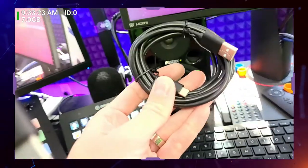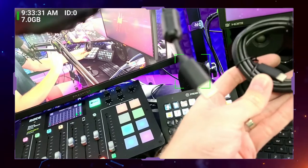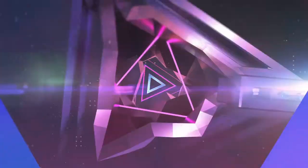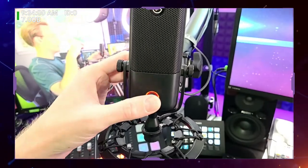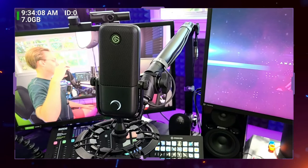Once you've done that, take your USB cable and plug in the mic. Use the USB-A side of the cable into your computer, and the USB-C side goes into your mic. Turn the mic to the side on your shock mount, plug it right into the USB jack nice and snug — you'll hear a click. When you do that, you'll get confirmation that the mic is properly set up and working because the volume dial on the front of the microphone will light up white. If you press the button, it'll turn red, confirming the mic is powered up and connected to your computer. Once you've done that, you are done with the hardware side of the setup.